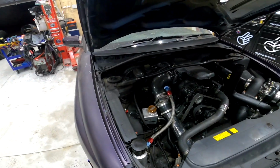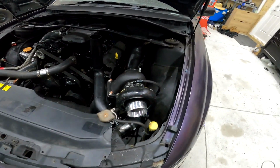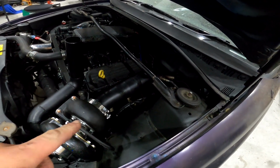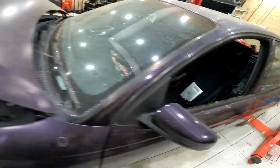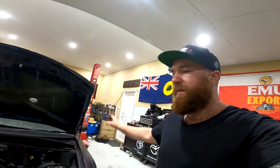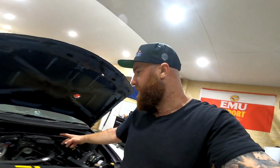Yeah, so another quick look at the engine bay for you. This is also running the LS coil driver, in case people forgot. I've rewired and moved the DFI and everything, so it's tucked up under here and you won't see it. It also makes it easier for when I put the Link ECU on this, I can just tap into the wires that are all there. I don't have to worry about the DFI wiring, and the crank angle sensor wiring will already be in the cabin for me to just wire into.